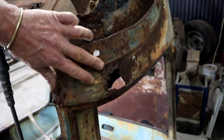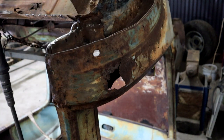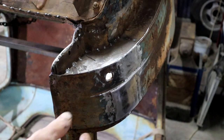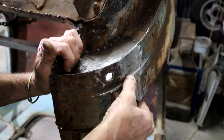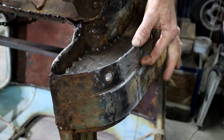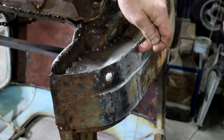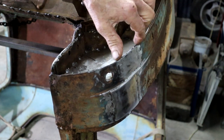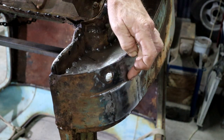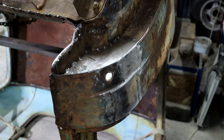Oops, another hole. Should we give it a band-aid? Why not - I'm on a roll now. So what was supposed to be just a little band-aid here turned into a skin transplant. The steel in this area was so rotten that I cut it all out and installed a little patch plate in that area and welded it up. And obviously I ground it a little bit to make it look nice.